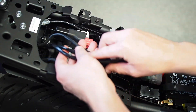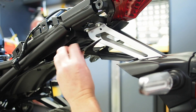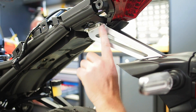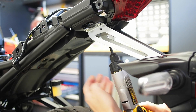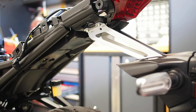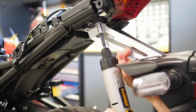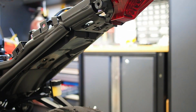You can see the three harnesses we need are all going straight down to the fender, which means we can take the factory fender off. Going back underneath the motorcycle, we can now take off the little trim panel by sliding it forward. The first piece that falls is not being reused. Then there are four eight millimeter hex head screws that need to be removed — note that these do have factory lock on them so they'll be a little tighter than normal. On the last one, take the fender in your free hand to make sure it doesn't fall or leverage those screws, then feed all the cables out and take the fender down.